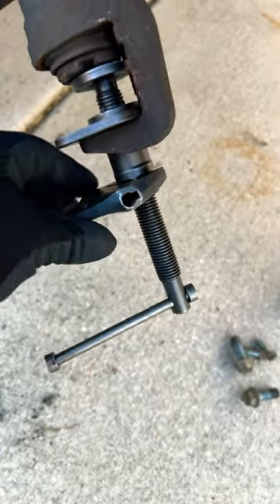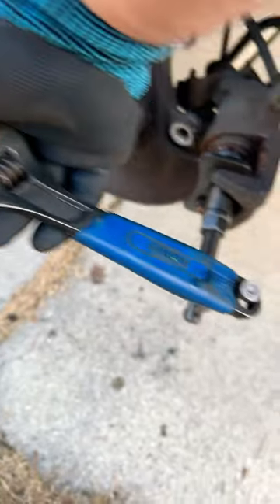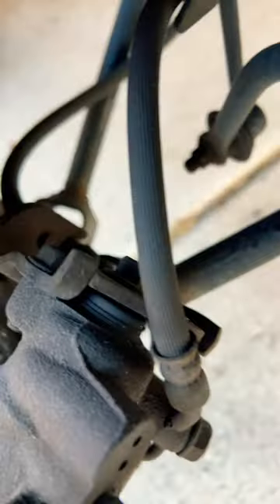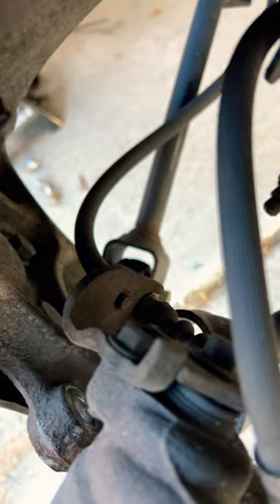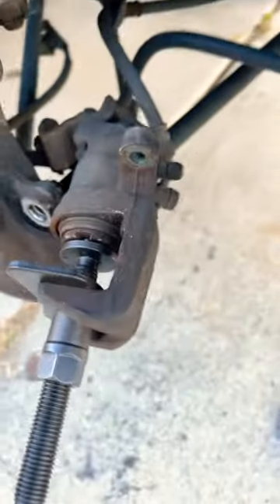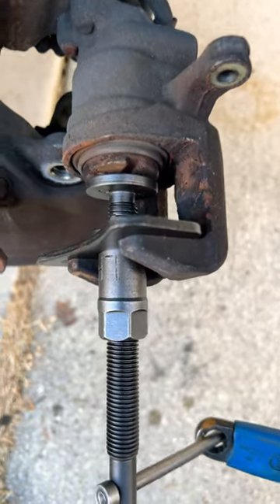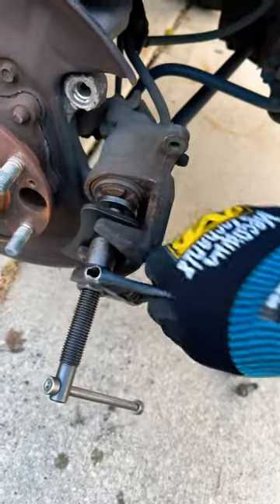I use an adjustable wrench to keep this part tight right here, and I put this wrench on the little rod to help get some leverage. Be careful because you do have brake hoses connected and a brake parking brake cable connected in the back of the caliper. Turn that piston in — make sure you keep tension on that.